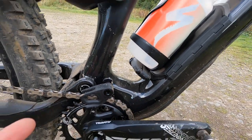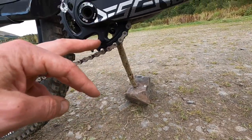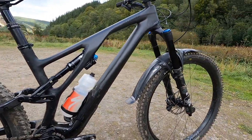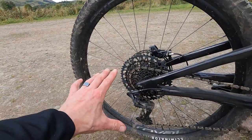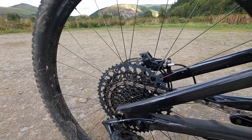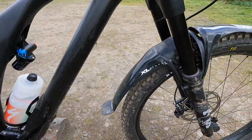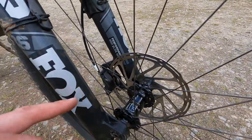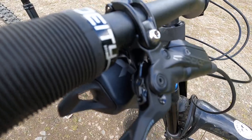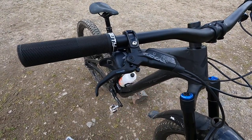I'm a massive fan of SWAT — great to see that on there. You've also got the little EMT multi-tool on the back. While we're down here, you can see it's got a chain guide on there as standard, and ISCG mounts — a relatively rare thing these days — but when you've got a 63 degree head angle it's great that you're getting the facility to have a properly stabilized chain run. Out the back, the Expert gets X01 SRAM Eagle, so you've got a 10-52 cassette on the rear, and nice big 200mm rotors with a Code caliper — the big proper downhill stoppers. Up front a 200mm rotor with a Code RS, so you're getting the proper swing link for extra touchiness in the lever feel.